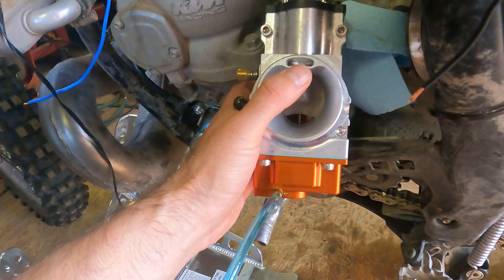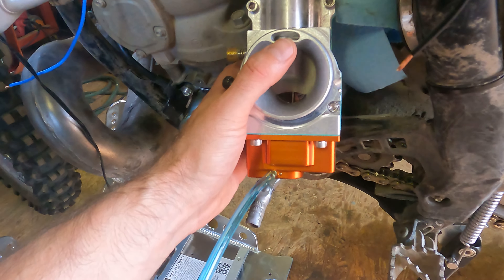There's a vent inlet here — that's what creates the constant pressure on the float bowl, and that's what solves for elevation change. The manual says some boots can cover this up slightly and then it won't work properly. We're going to pull the filter once we get this installed and take a peek to make sure it's good. The fill process is: leave the choke open as you turn the petcock on slowly and let it fill with gas and replace the air in the float bowl.